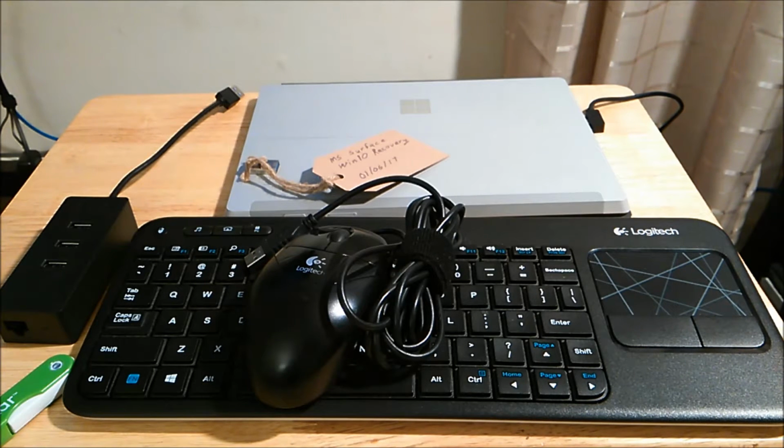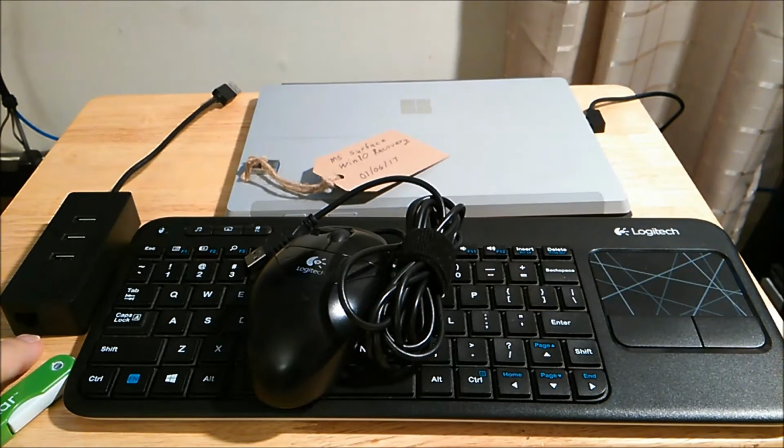The reason for that is, for some reason, the Grub installer included in most of these Ubuntu derivatives is missing something that it needs in order to install on the Surface 3. And when it finds it's missing it, it tries to go out to the internet to download it. There's several bug trackers on this, and what they have found is that, as I said, Grub tries to download it from the internet. The problem with that is part of the install, for some reason, turns off the wireless adapter in the Surface 3. And if it's not turned back on, I'm not even sure if it's able to be turned back on, before it tries to go out to the internet, the Grub install will fail and it will not boot. So you need this Ethernet port adapter, and you need a hardwire.